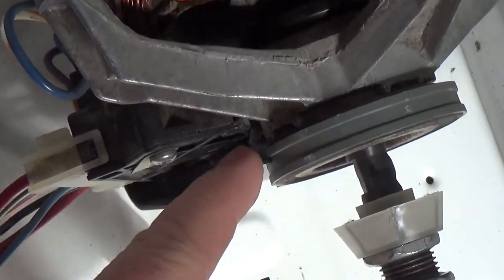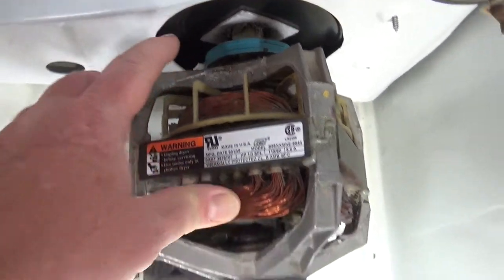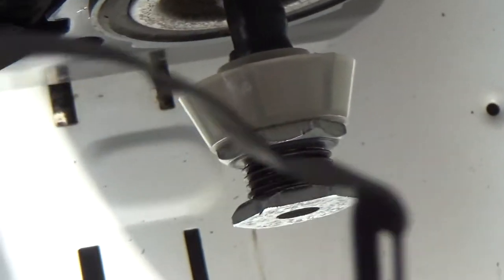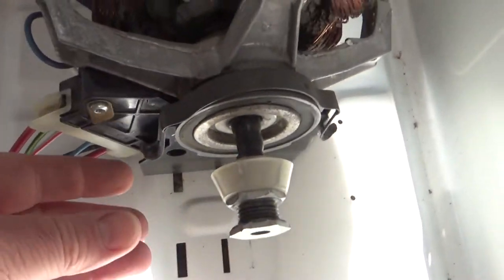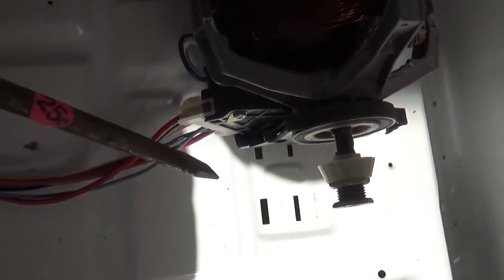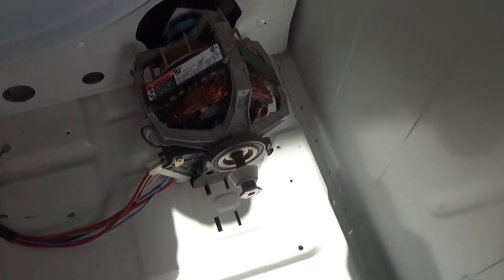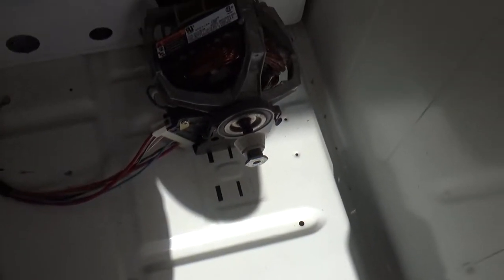Here's a close-up: this little bracket just fits inside this groove here, and same deal in the back. There are little dimple marks — the clip has little dimples that keep it from moving, which makes it tricky to put on. I put the left side on first, then take a big screwdriver and press down to get it to go on. You'll have to fight with it, but eventually it clips in. Do the same in the back.